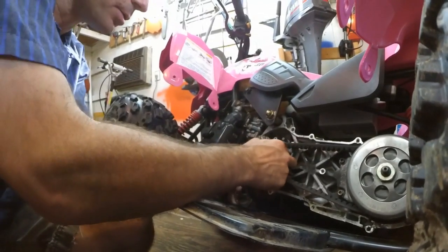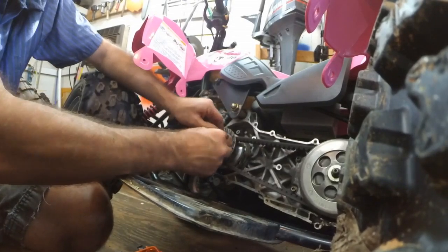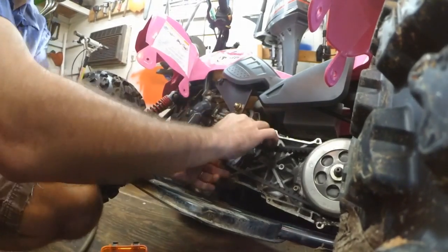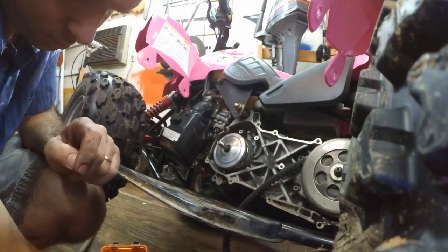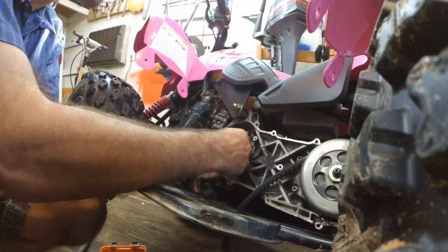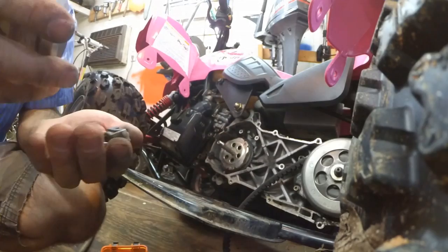So behind it is the gear, and that gear is stuck. So we'll need to pull this off, get this whole pulley off, and look back here and see what's going on. Alright, so I hit the center nut there with an impact gun, washer, star washer there. And the belt's off, out of the way. Got a spacer and a washer. And there's the rollers that you can change if you wanted to change rollers.